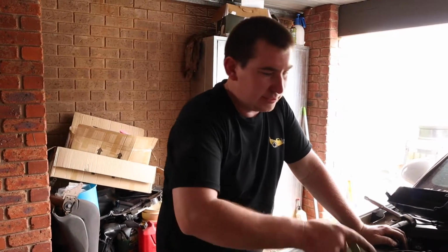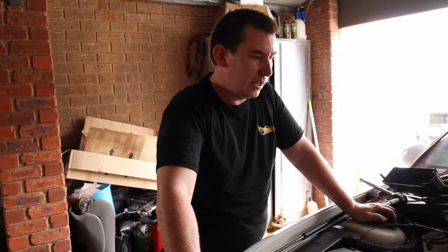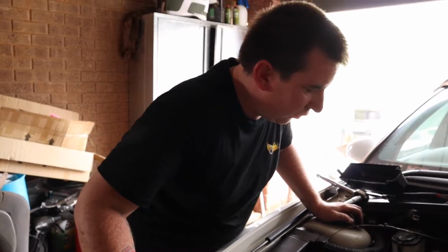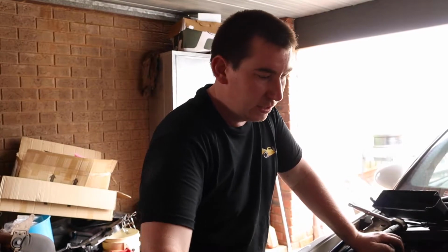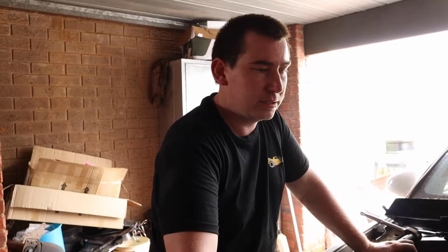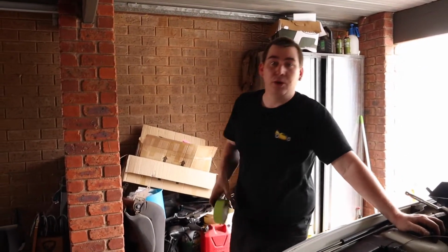So far, we've got the intake manifold off, we're taking the belt off, I've still got to finish getting two bolts for the compressor underneath, we're starting to take the whole engine loom off the engine, and spark plugs, exhaust. At this point, and the starter motor wise, I've got to take the alternator one still off. Other than that, we haven't got power to anything, which is good. Then I suppose I'd better go underneath, take the tail shaft off. Take the gear selector off and undo the multi-pin plug that goes into the transmission, which are glued in from factory.